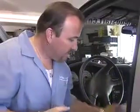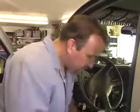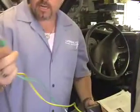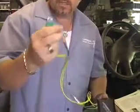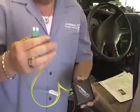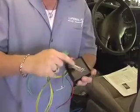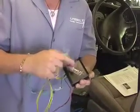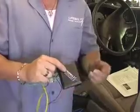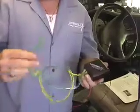One of the questions we've been asked the most is about the installation instructions — when you plug in the yellow or green leads from the life belt receiver into their respective fuse ports, they are polarity sensitive. If you hear a loud buzzing sound, that's the relays in the life belt receiver taking power the wrong direction — rapidly opening and closing. It should be a clicking, but it's happening so fast it sounds like buzzing.